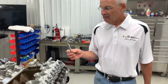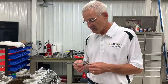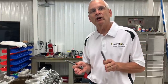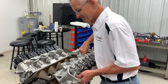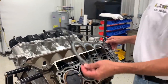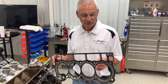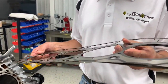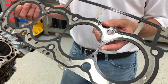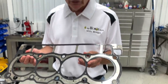The head bolts are a large head bolt — a little over a half inch in diameter, 13 millimeters — and the nice thing is they're all the same, uppers and lowers. They're conventional deep head bolts down the block, which helps with bore distortion and ring sealing. The head gasket is a nice multi-layer steel head gasket, four layers on this one. Multi-layer steel has been used for many years in the aftermarket and by Ford — really good sealing and it doesn't overload the top of the bore, keeping conditions good for minimizing bore distortion.